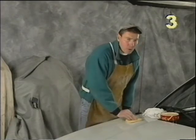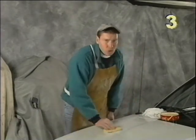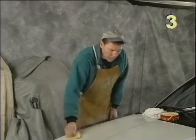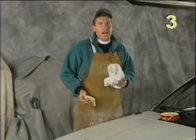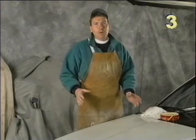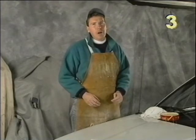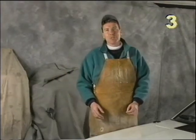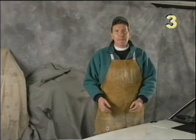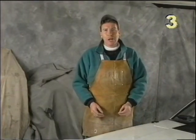I'm now applying my light coat of carnauba wax. We're going to put this on, let it dry to a haze, and buff it off again with our clean cotton towel. Once we get done with that, I'm going to follow up again with our dry pad on our polisher and just give the car a final buffing. The paint on our Mustang was in pretty good condition — but now let's take a look at some paint problems where polishing can really help out.